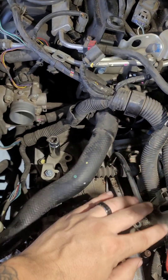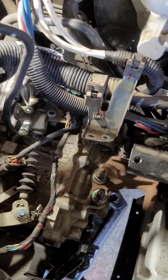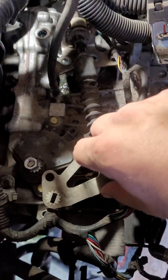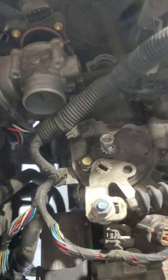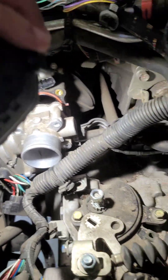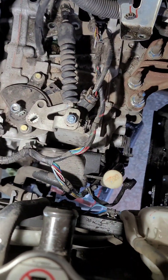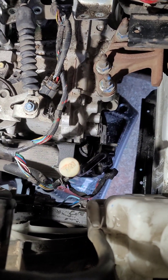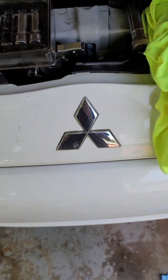I'm going to try to get most of this out of the way to make it easier to get the transmission out. I've got everything disconnected — the only thing I haven't loosened yet is the bolts to the bell housing on the motor, which I believe are 12-millimeters. I'll point them out when I get ready. I drained the transmission pan — the fluid was clean since I just changed it not long ago.